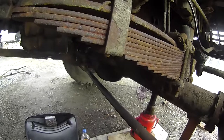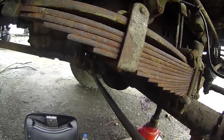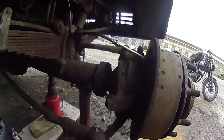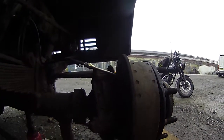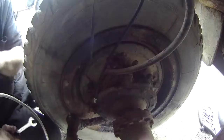And that will then give me fluid to the front brakes, at which point I should be able to press the pedal and actually have the master cylinder pump fluid. And then I'll be able to see if these move. Which sounds very exciting. Well, it doesn't sound very exciting, but it will be anyway, because it's been such a long time and it has taken me so freaking long to get anything done on this.